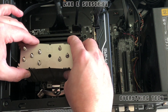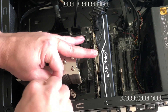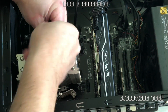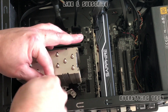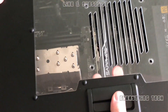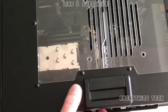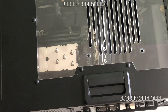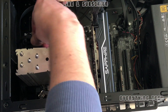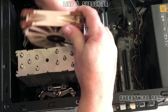Now it's time to put the heatsink on top of the CPU and line up the screws. There's a little retention, so if you screw one side in the other may be difficult — just barely attach each screw first, then press the cooler down to attach the next one. Remove the fan for easier access, or better yet plug the fan in before attaching the cooler. This cooler is 158mm tall, so make sure your case has enough clearance — mine just barely fits.